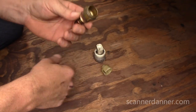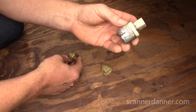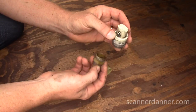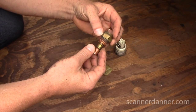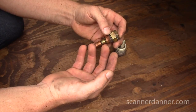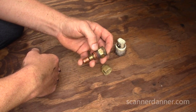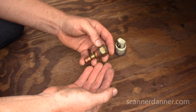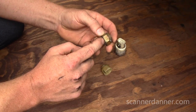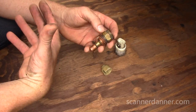This is a 215-degree temperature switch. By the way, this particular device is typically used to control a cooling fan, but for whatever reason the RV manufacturer decided to use it for the idiot light — the overheat light. It was difficult to locate because I didn't know the temperature rating. For our cars, 230 degrees is when a cooling fan turns on on a lot of systems, so I figured for an overheat condition it had to be at least 230 — thinking 240 or 250. I was shocked it was 215.